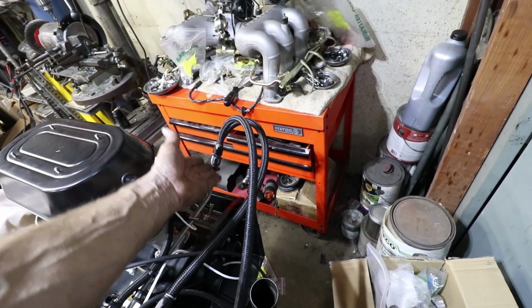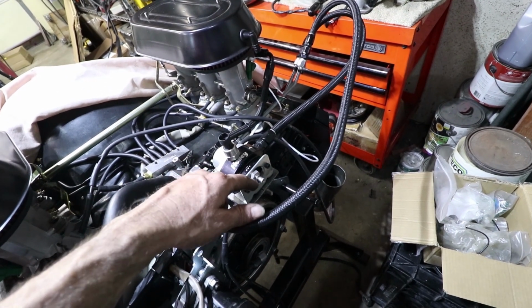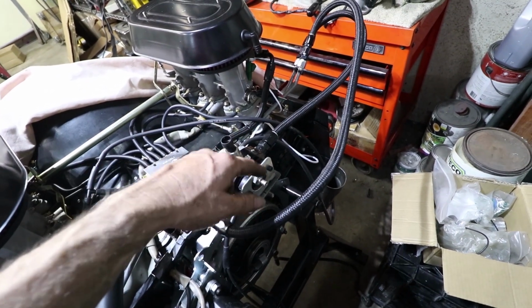That will just be real quick to the regulator. And the regulator has this return line. It's low pressure to the fuel tank. That's the one that connects to the new fitting I just made. That was a fun project. I'm happy with the access now to the fuel lines, and they're basically lower maintenance and higher reliability. So that's a big win.